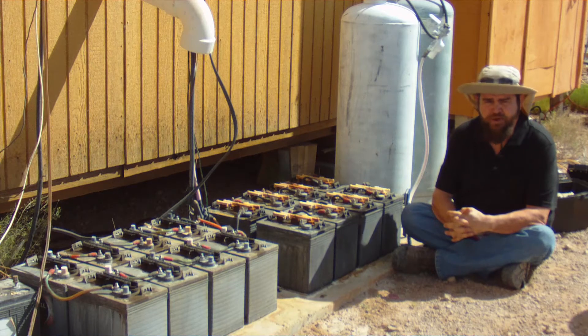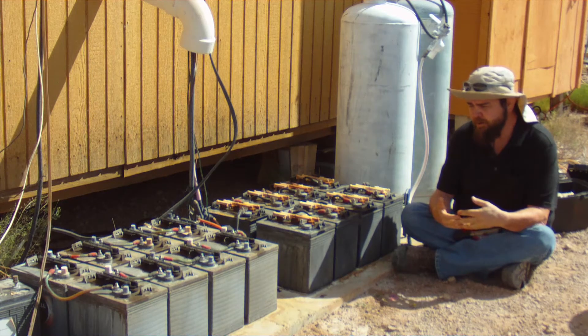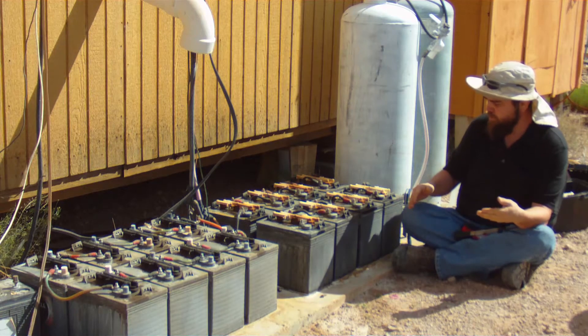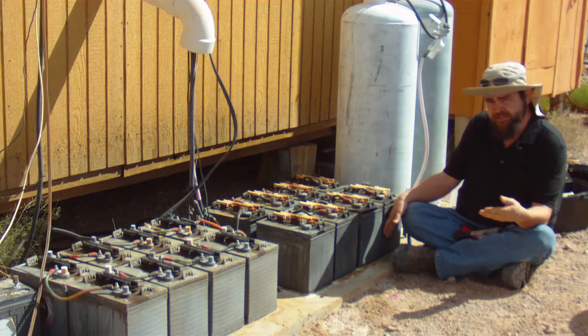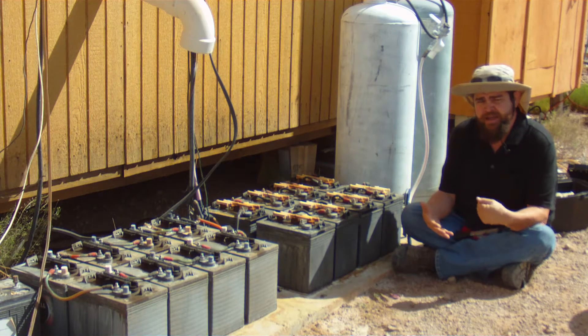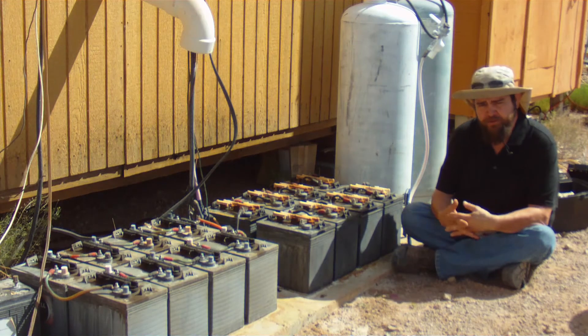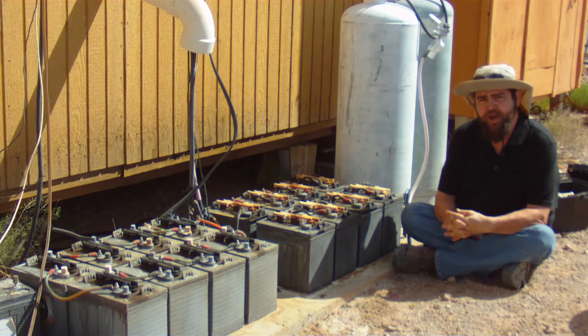Also, you want to keep track of the ambient air temperature, but better is to record the actual temperature of the electrolyte or the battery case, because the electrolyte will vary in density based on its temperature. If you don't have a hydrometer that compensates for temperature, you'll need this information to get accurate measurements of the specific gravity.